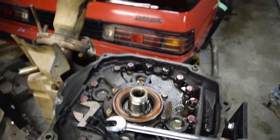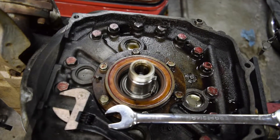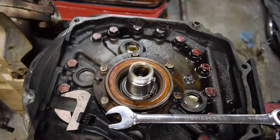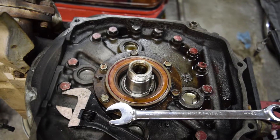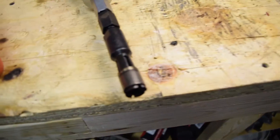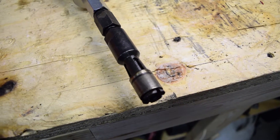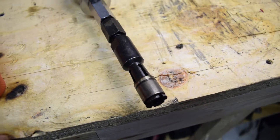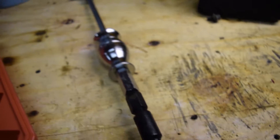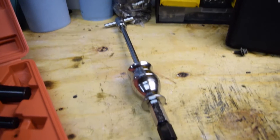What I did was I bought a super cheap puller on Amazon. If you look here, the pilot bearing is out — it's actually still sitting on the part over here. This is a pretty simple bearing puller. It's called a blind bearing puller, is what we found on Amazon. It's only $20, made in China — super cheap tool, but very much worth the money.